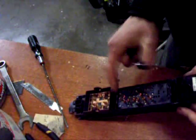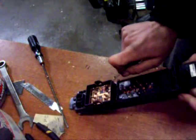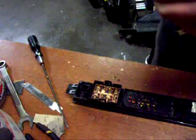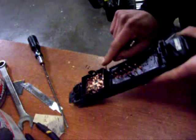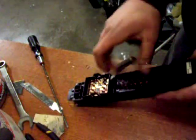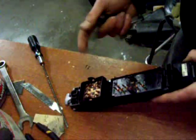There are little tabs on both sides you've got to get to. I like to slide it in there — a little bit thinner one, maybe 21 thousandths, that'll work. You get it in there and you slide it in so it pops those tabs off, and then you pry up like that and it pops.